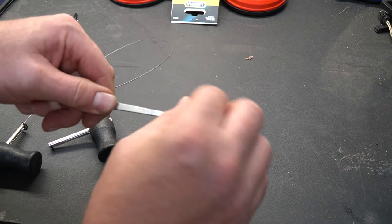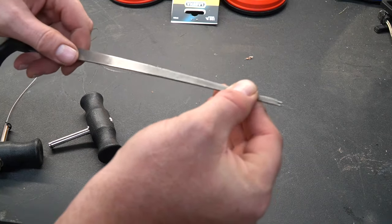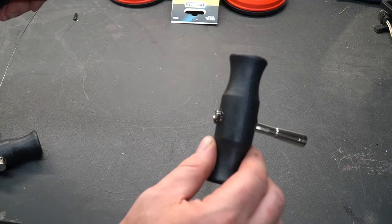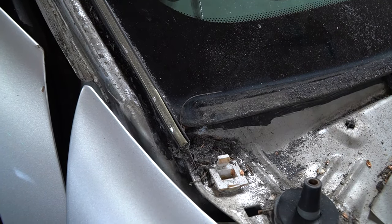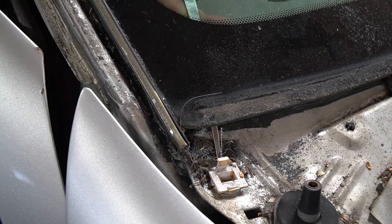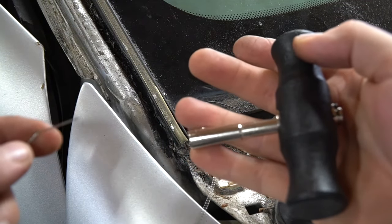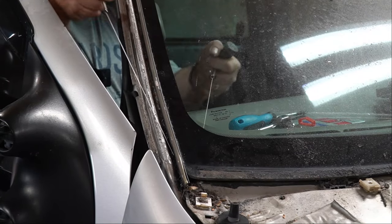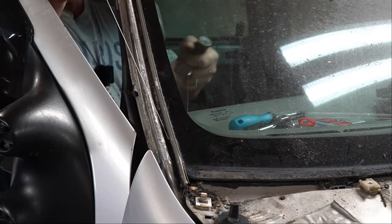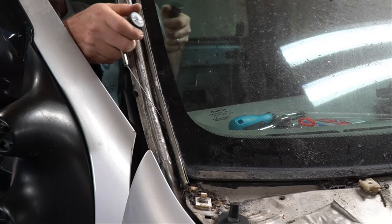On the other end, don't put the handle on right away — instead put it into the fork of the starter tool and fold it over, giving it a good pinch, because this is what you shove through the seal from the inside to the outside. I find the easiest spot to start is in the corner of the windshield. Come in from the inside and give it a good shove — it should push right through the urethane. Once you have access to the cable on the outside, pull it through, hook up the other handle, and you're ready to start cutting — just sawing back and forth like any rope saw, working your way up the edge. This takes a lot of effort, and sometimes you need two people coordinating inside and outside.